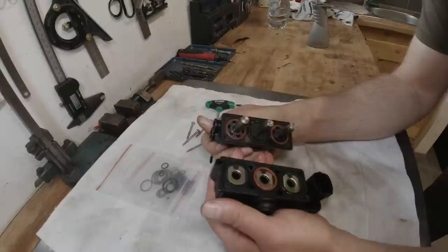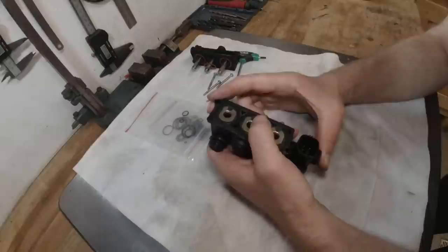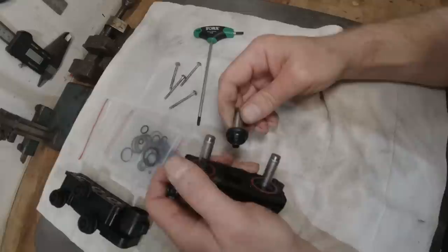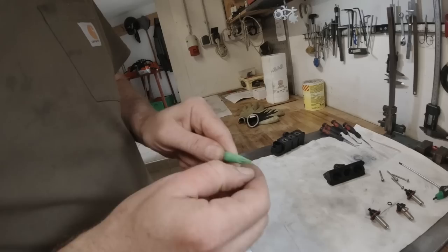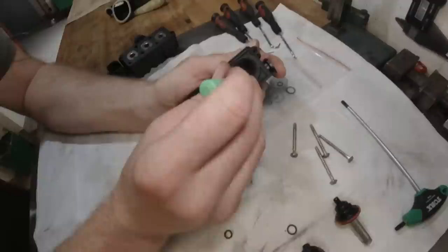They have red O-rings and we have black O-rings. I don't think there is more to be disassembled on this side because these are the solenoids, and you can see all this dirt here. So we're going to clean all this out. The middle one is different from the outer one, and all I've got to do is pull on them. Start with the middle one — there is the middle one out. I made this out of an old iPhone tool so I don't scratch the ports when I pull these out using a metal pick. iPhones and Land Rovers go well together.